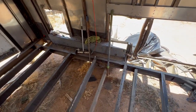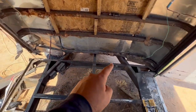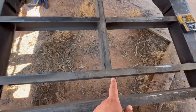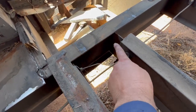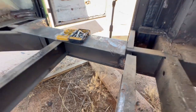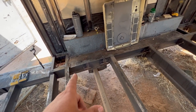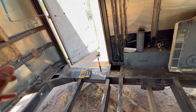The full floor is removed. I found a few concerning things but mostly stuff I can fix with my skills. First, I need to gusset and strengthen that area up there — that seems to be one of the strongest load-bearing spots on the trailer, so I need to make it more rigid. Back here where the center support for the tongue comes in it's a little questionable. Right here I really do want to gusset because that's the only point of contact to the frame — and it looks like it cracked again, so this frame is weaker than I predicted.